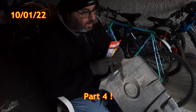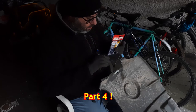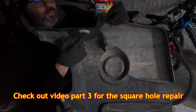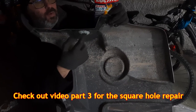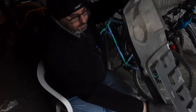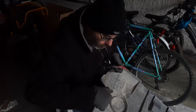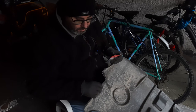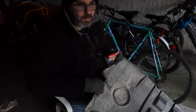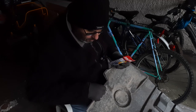Welcome to part three or four of repairing the dash funnel. Before Christmas I repaired this part of the hole to make it square again. The idea is to use some super glue to reinforce it a little bit, because with this being plastic putty it has a tendency to not adhere properly to the plastic and can snap.